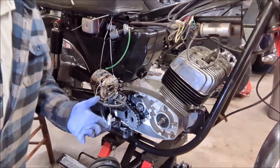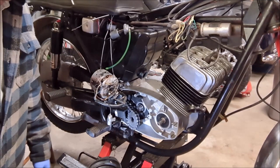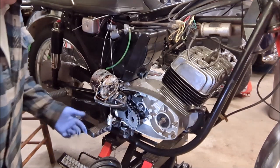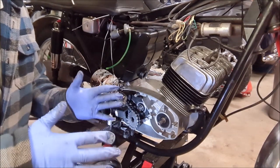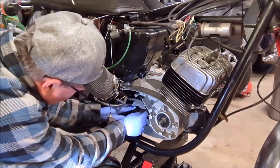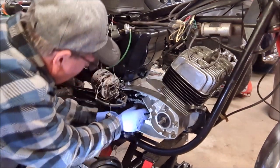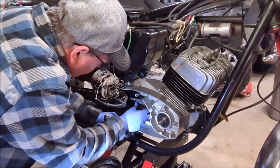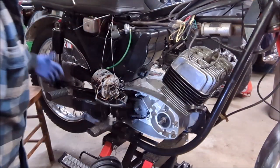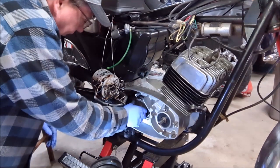As I'm sure you were all yelling at the screen - I just loosened the back wheel, moved it forward a bit to give a little slack in the chain, and now it's going to work. There she is, chain back on. Now all we have to do is tighten it up to the proper tension and that bit is done.